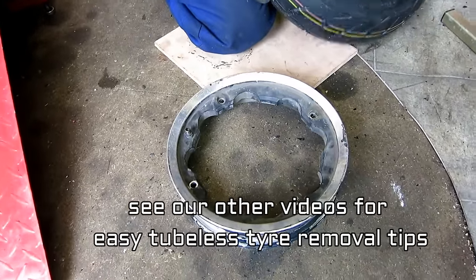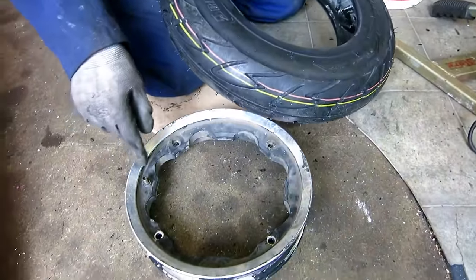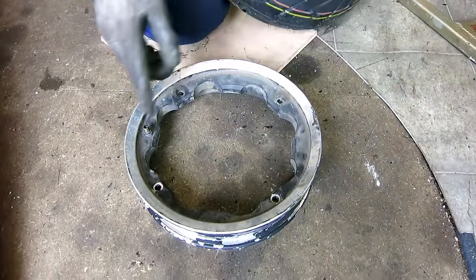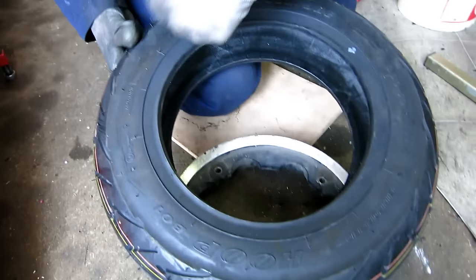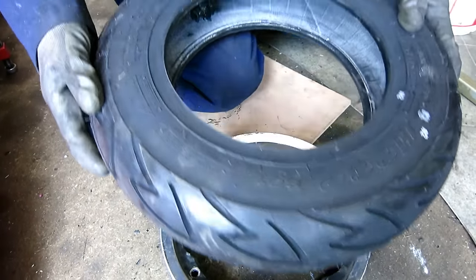You have to make sure you get your rotation right. On a Lambretta or Vespa, on the valve side, the rotation should be anti-clockwise. This tyre has a rotation pointing clockwise, so it needs to fit on the other way up. Rotation anti-clockwise — we're laughing.